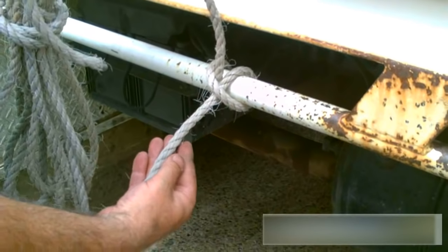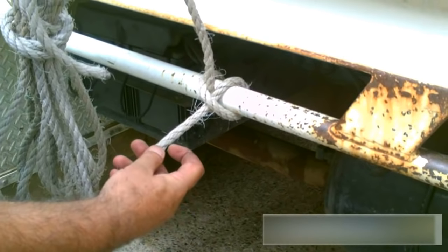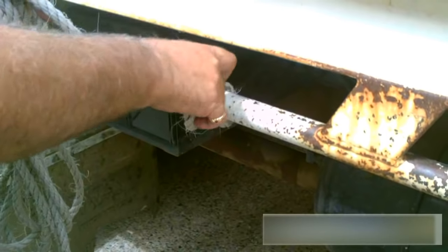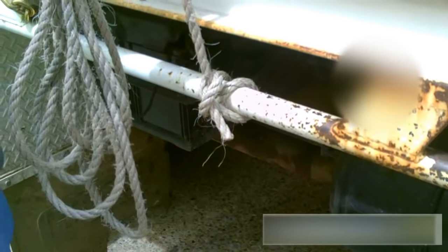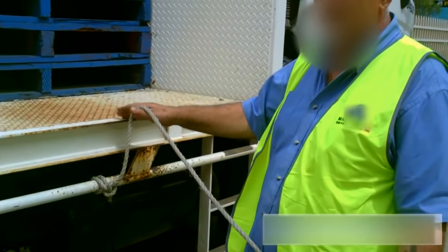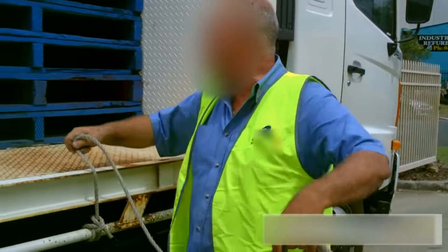We're not allowed to have more than 100mm or a 4 inch tail. It's probably quite wise at this point to do a half hitch on that rope as a safety measure — that will stop it from coming undone. Ensuring that there are no pedestrians, no people or objects on the other side of the vehicle, we'll then throw the rope over the load.